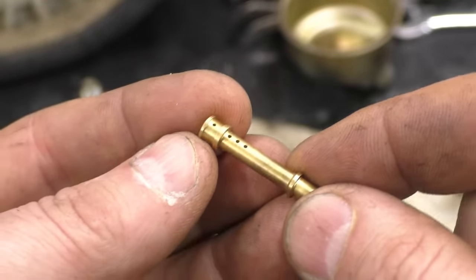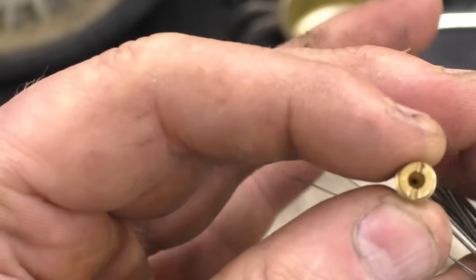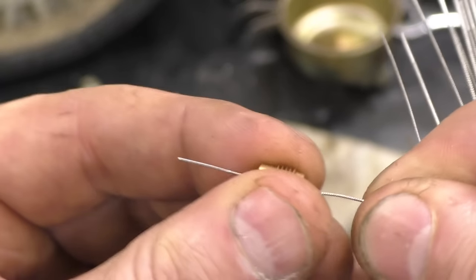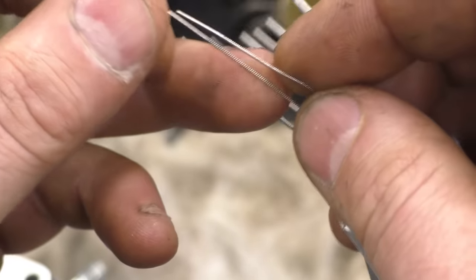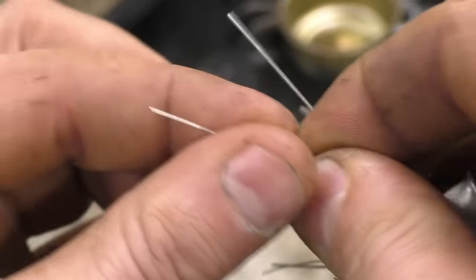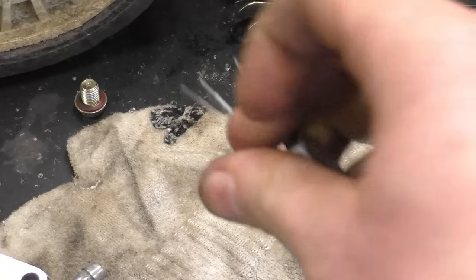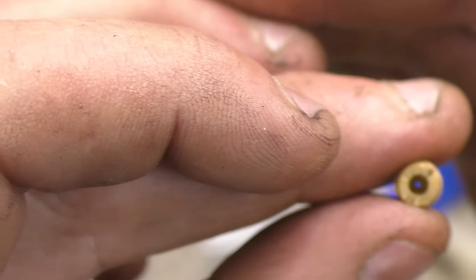Now this is the main culprit here. If you try to look through it you will not be able to — it's plugged. It doesn't take much to plug up these small jets with today's gas. You can park your machine in the fall and in the spring it will not start. The best way to put your machine away is to run it completely dry, take the carburetor bowl off, let the carburetor dry, and then put it away. That's a hundred percent guaranteed to start. Fuel stabilizers and that stuff do help, but they're not a guarantee. Using premium gas may also help — the blend might be better and have a longer shelf life.